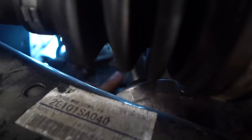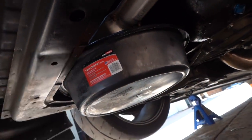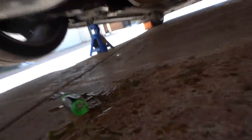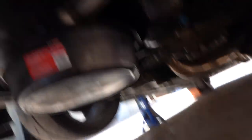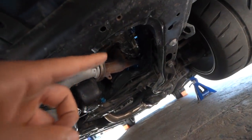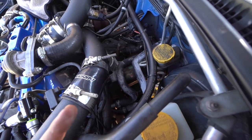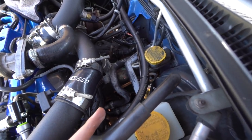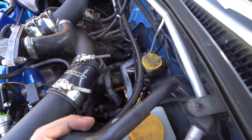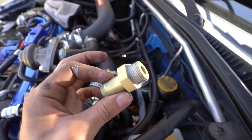Right there — there's the galley plug, that's the one we're getting out. Finally got it, and I realized this little ridge on the pan holds the drain pan up perfectly. It's inevitable — when the coolant goes, it really goes. Anyway, got to clean this up. Now, finally got that plug out — it's a 12-millimeter hex. I ended up getting it from the top; it was pretty difficult. Maybe I tightened it too tight during the engine reassembly, or maybe they're just tight normally. It did have some loctite on it.